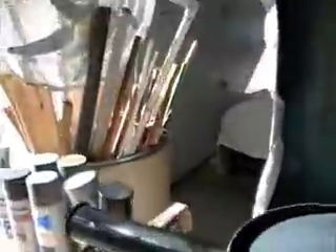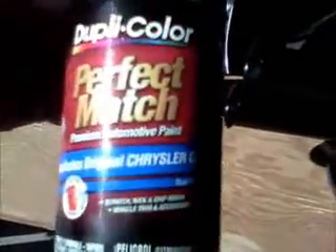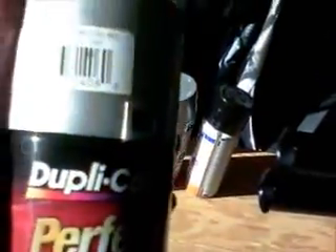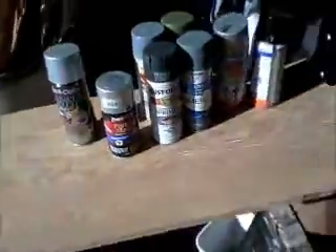I'll show off my workmanship here — I got the inside of the headlight housings sprayed in metallic silver. I sprayed these two with rattle bombs and boy, they sure came out nice. I had two coats of primer, did a little wet sanding on the primer to get it looking good, and then used a rattle bomb from AutoZone or O'Reilly Auto Parts. It was a Chrysler match — radiant silver metallic. Looks great. I also have some Duplicolor engine enamel in silver that I was going to try, but I stuck with the body paint and it turned out okay.